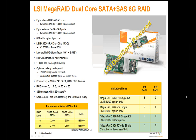So you wouldn't quite get the 400,000 IOPS, but you would get much more than you would with spinning drives. Correct. Or to your point, you may have to have like 200 spinning drives, you could have just a few spinning drives and a couple SSDs. And if your data is cached on the SSDs, particularly think about reads, right. If you have a good 20% or 10-15% of your application data hotspot on those SSDs, the IOPS just explode for a much lower cost.